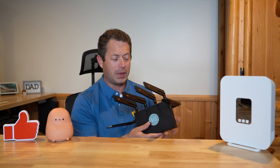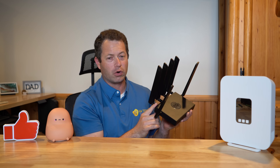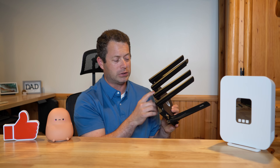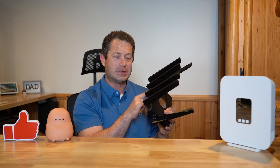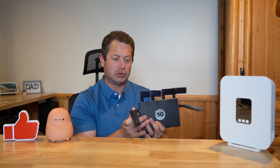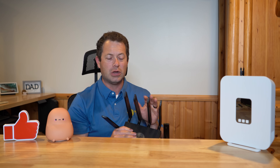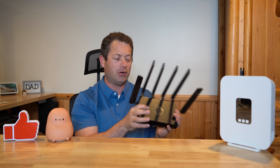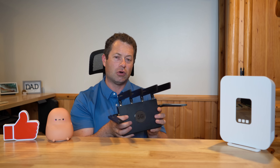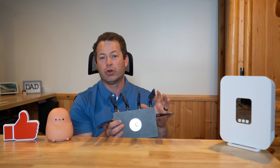What we're going to show here is taking the SIM card out of the white T-Mobile gateway and putting it into the Main Event. There are actually two slots you can choose from, and this has very easy settings that allow you to do things like IMEI revision on this unit. You can also change the APN if needed, or your TTL or other settings depending on your plan.